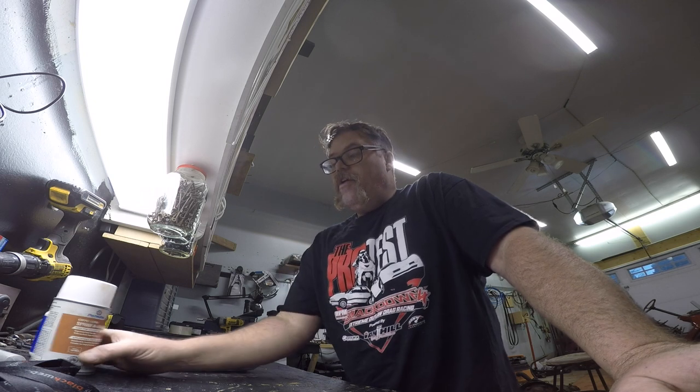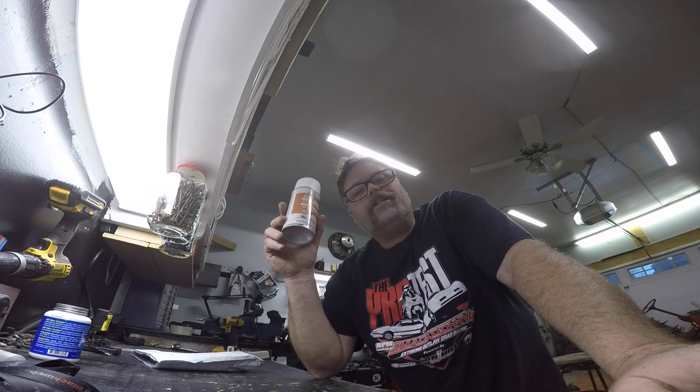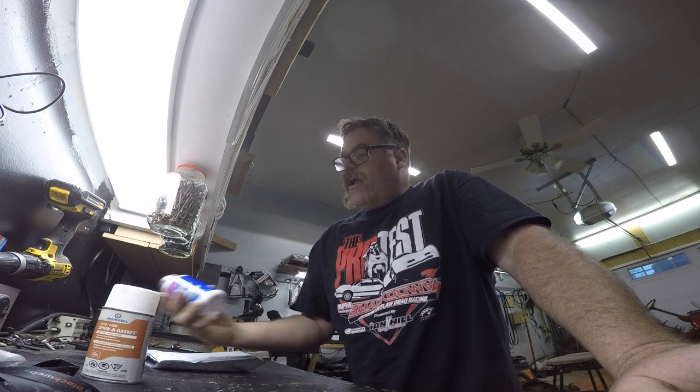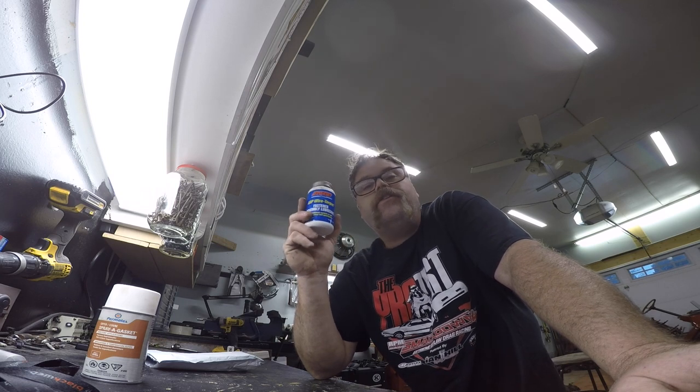So here we go. First of all, I ordered some copper gasket spray. Some guys use this, some guys don't. I'm going to spray it on my head gaskets before I install them just to give them that little extra bit of seal. I got the ARP Ultra Torque compound, which I'm going to use on the studs.